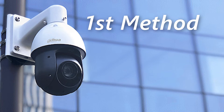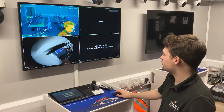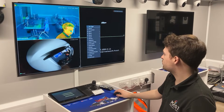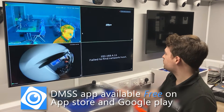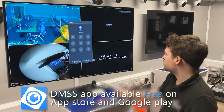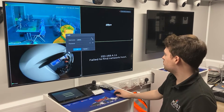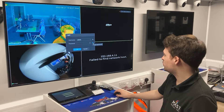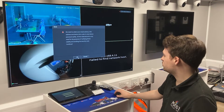The first method of password resetting we're going to do is the QR code for resetting the NVR's password. First, you'll need to have a recovery email set in the account settings, and you'll also need the DMSS app. From here, when you try to draw the pattern, you can click 'Forgotten Pattern' and then click 'Forgotten Password'. On this next prompt you can click OK.